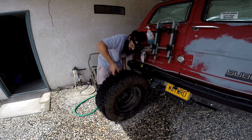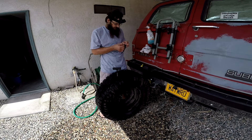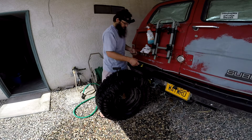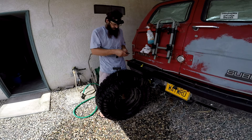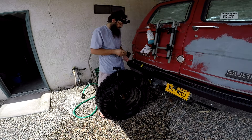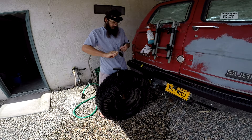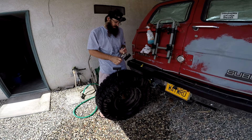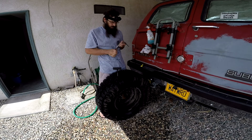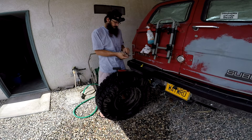Drastic tires call for drastic measures. Now you want to take the plugs — these ones are pretty basic, but they've always worked well for me. I only pull it about halfway out so my fingers get less sticky. The whole trick is to get this through the insertion tool — this tool is actually fairly nicely finished, a lot of them aren't. Use pliers or needle nose to pull this through. Don't use your teeth, people — no, it's a non-teeth job. Pull it all the way off the packaging and get it about halfway through.